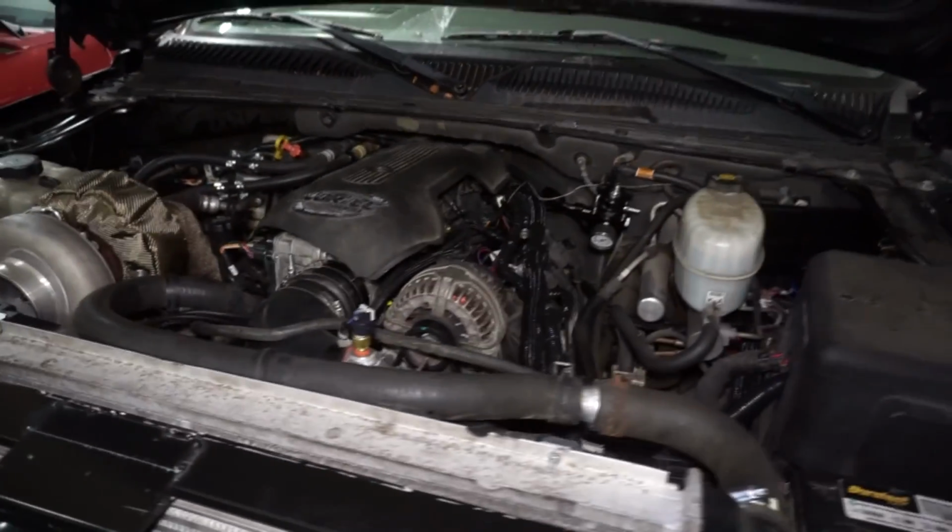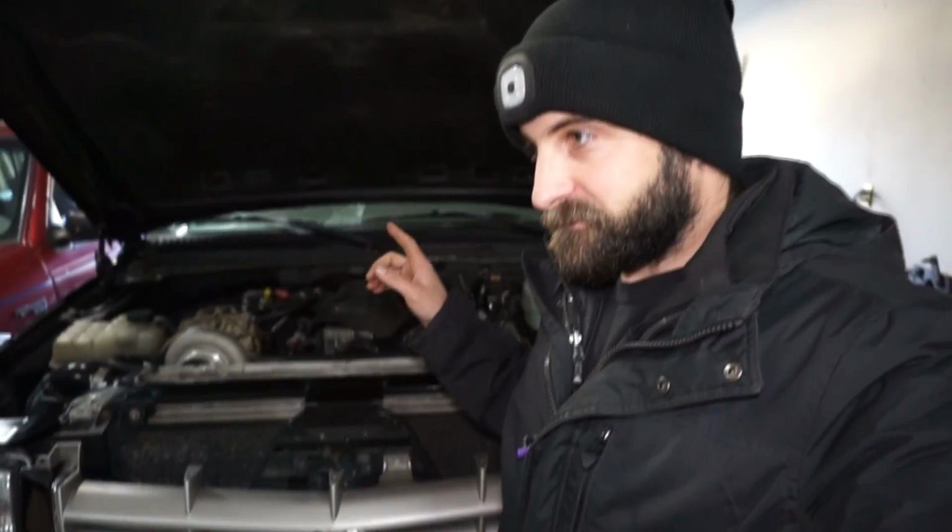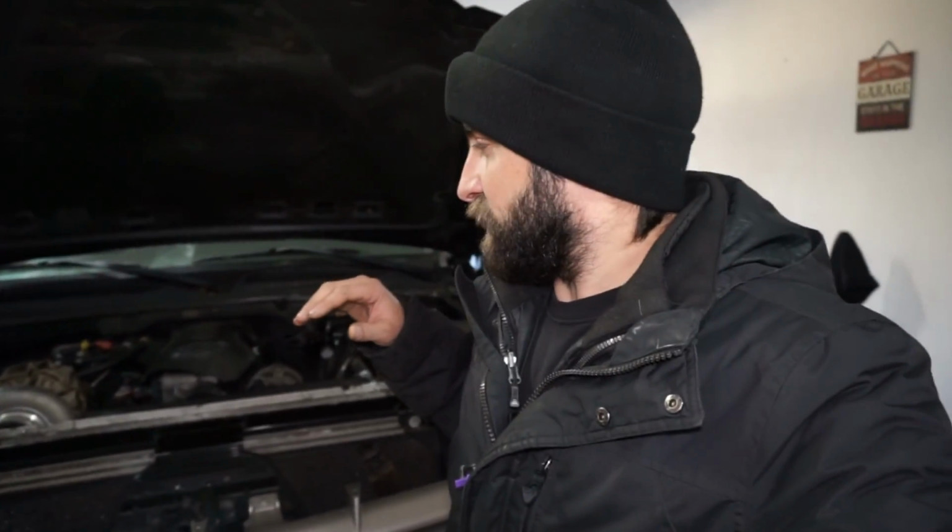So let's go drive it and get that valve to open. I think it'd be a good test to see, one, how much noise it makes, and two, if it goes any faster with an open cutout, because right now it went 13.7 through full exhaust on like 15, 16 pounds and 12 degrees of timing. So we'll leave everything the same, get it back to that same level if it lowers the boost, and then see if it makes any change with the cutout open.